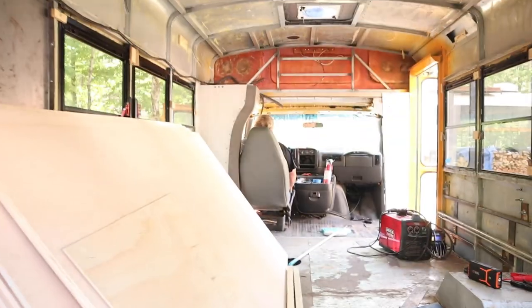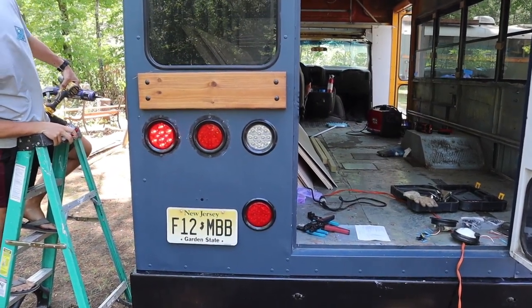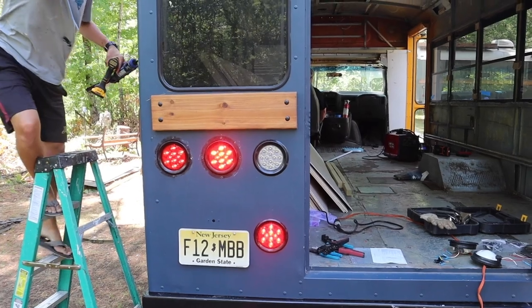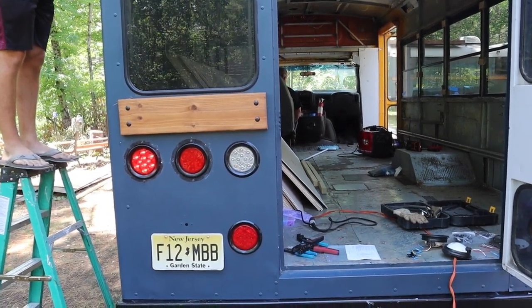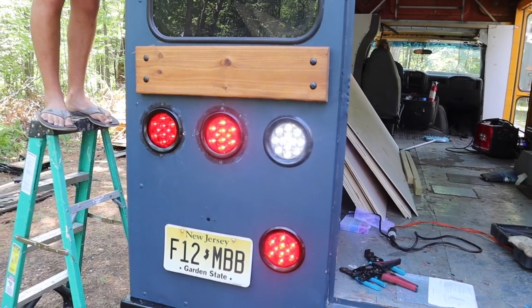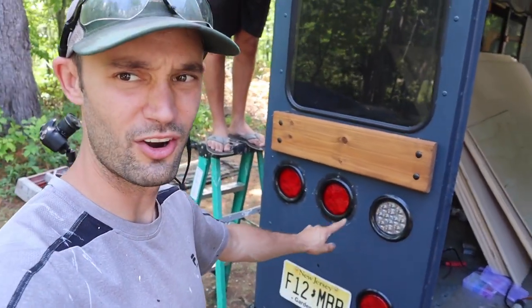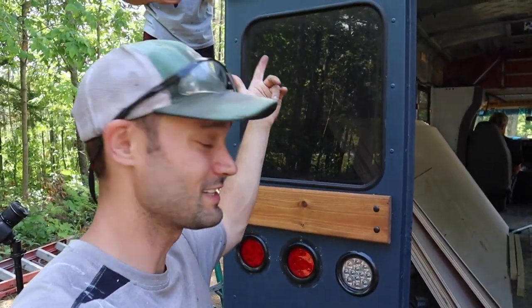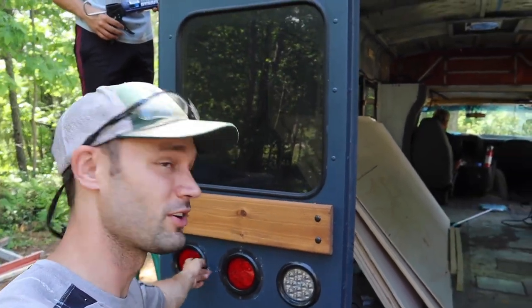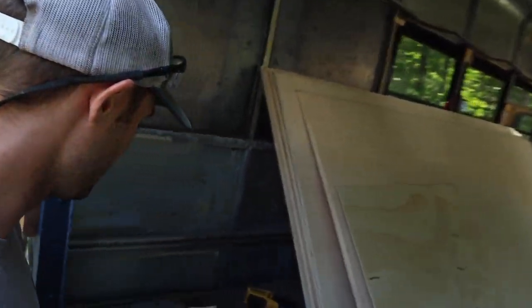Just put the ground screw in — Dale's ready to go. Let's see if we made it work. Try the brake and turn signal. You got the left turn on? It's not flashing. Can you put it in reverse? So we just confirmed our running lights — it doesn't seem like we're getting power, might be a ground issue. It might be that Luke's currently working on the marker lights, so maybe running lights aren't working yet. My turn signal isn't flashing, so that could be a relay or a wiring issue. I've got a little bit of investigating to do.